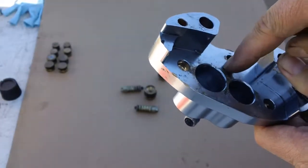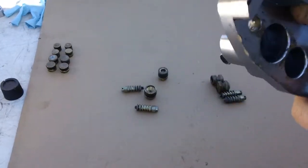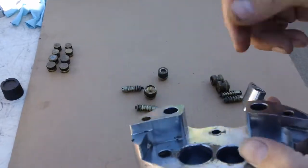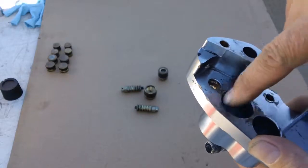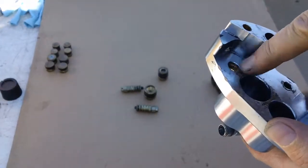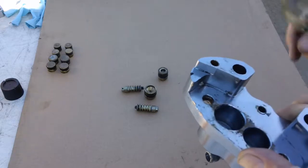You need a good seal between the piston seal and the caliper, otherwise the brakes are going to leak. Go-kart brakes are notorious for going bad when they sit — that's why this system is coming apart: it's been sitting, the calipers leak, and they don't retract. I'll clean the inside with a little Scotch-Brite, but you don't want to go too heavy since these are anodized aluminum — you don't want to deform the bores, so make sure it maintains a nice seal.